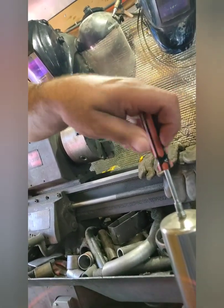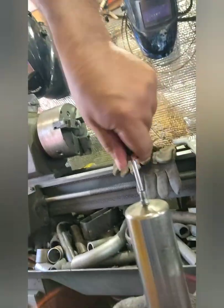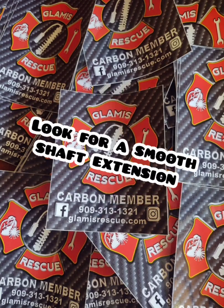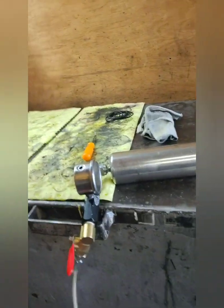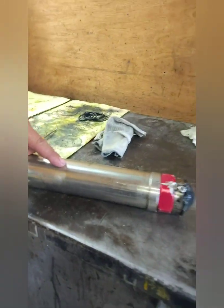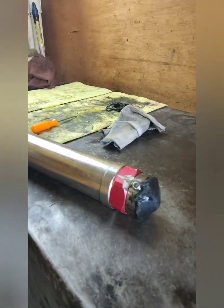I pressurize them to 150 PSI and let the customer do the final adjustment — some guys want it at 50, 75, or 200 PSI; those numbers are up to them. I pressurize it to verify my work. When I pressurize it I watch the shaft: if it jumps, something's wrong internally. If it's a smooth, slow transition out, I did my job. Nitrogen next.